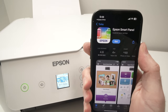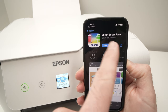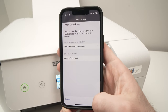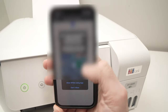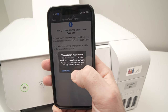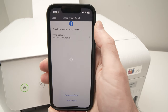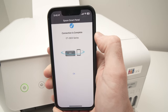On your smartphone, download the Epson SmartPanel app from the App Store or Google Play Store. Just type Epson SmartPanel and go ahead and download it. Then launch the app, press Agree, press OK, press Next, press Allow once, press Next, press Allow. From the list you should see your Epson printer — select it by pressing on it. You'll get a blue check mark and the connection is complete. Press OK.